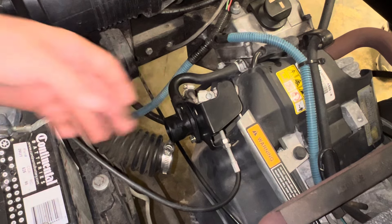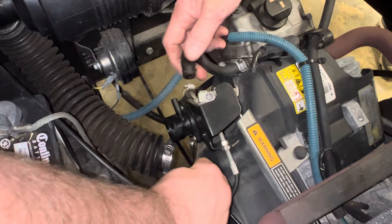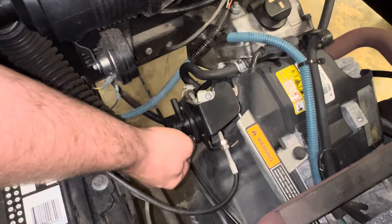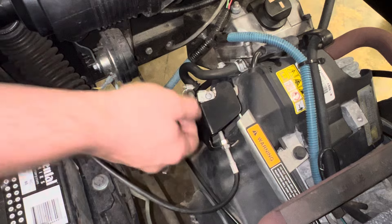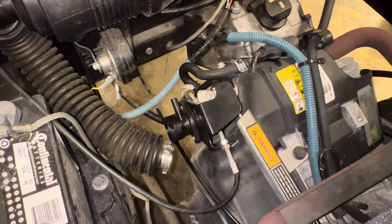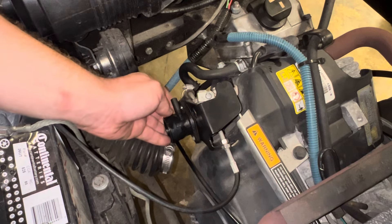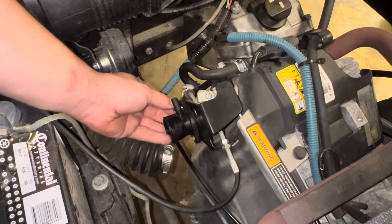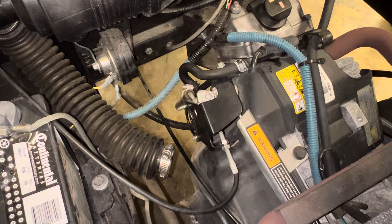What size bolts? What you want to do next, pull your ventilation hose off. The bolts holding the carburetor on are 10mm — you take them off. Let me tell you, that's the one socket that always gets missing. I seen this guy, he was on the side of the road and he died trying to find a 10mm socket — it was inside his water pump. He dropped it last time he put a water pump on.